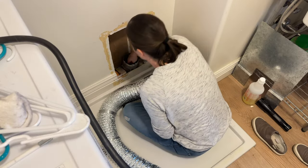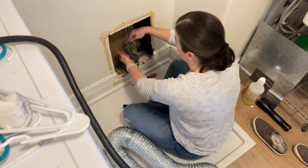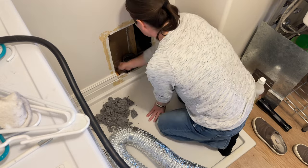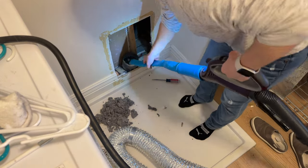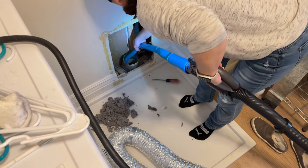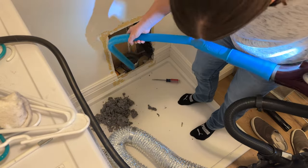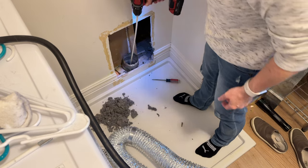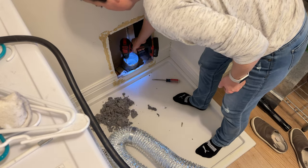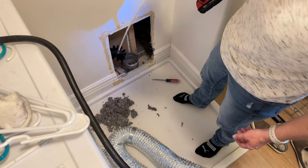As I was ready to put the hose back on, I saw there was more lint that had been pushed up from the outside. I removed as much as I could see, then took the vacuum with the blue attachment and shoved it down in there to get out as much as possible. I then used the drill attachment one more time with just one length — I probably should have added more, but I was concerned about getting it stuck again. It looked like there wasn't anything left.